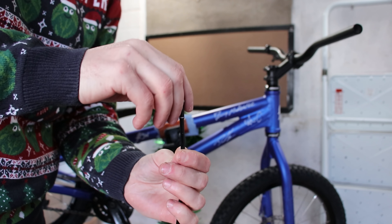In the box was some Inspired push-on grips. They have an internal bar end plug which needs fitting first. And to fit the grips I'm going to use some GT85 again. You may think I've gone mad - it is quite possible, I mean I did dress a cat up in a Santa outfit. But surely the same slippery spray I used with the cables would be the worst idea to keep grips in place. But no - for whatever reason, GT85 actually works really well. We used it in the bike shop I worked at, and the grips are solidly in place after just a short while. Plus I really like the smell. You actually have to be pretty quick though - they can grip before they're fully on. Now that we've got somewhere for our upper legs to grip, let's add somewhere for our lower legs - how about some Crank Brothers nylon pedals?